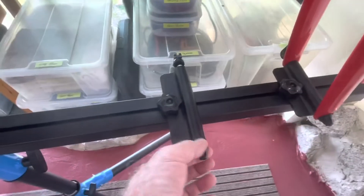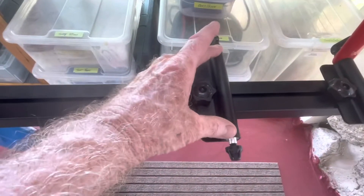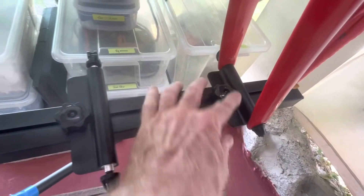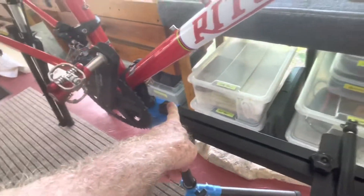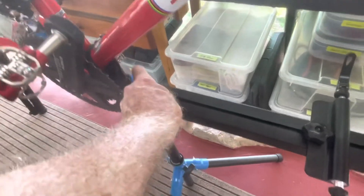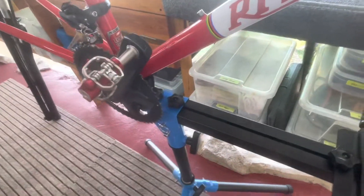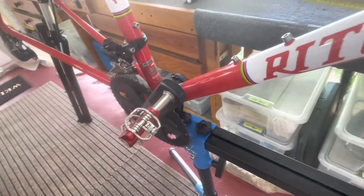With the Park Tool, you have one and they just give you spacers to put on in case you're doing the rear dropout — 130 millimeter on the road bike and 100 on the front. They have quick release levers to lock it in place instead of these knobs, which, once you've got it set up you're not really messing with it.